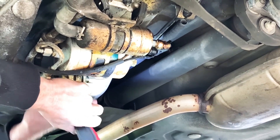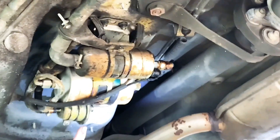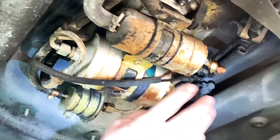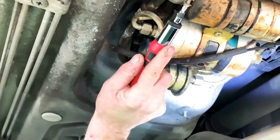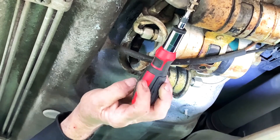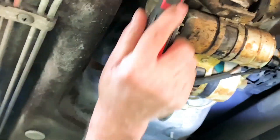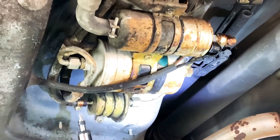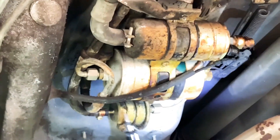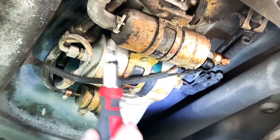We're going to slide it out. Now we've got to loosen the brackets here and here, and that lets the stuff slide in and out of the holder. We still have to take all these little bolts here loose off of the fuel pump. This is the feed side that feeds the pump, and the other side is metal — it pressurizes it and pushes it through your filter. It goes from the tank to here, out the metal lines, back to your filter, loops around, goes back over, then up to the engine. And you have a pressure regulator right here.